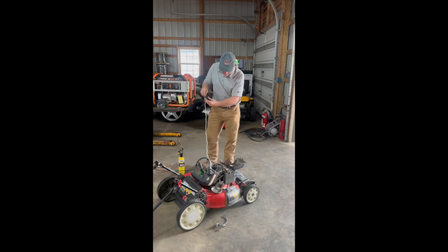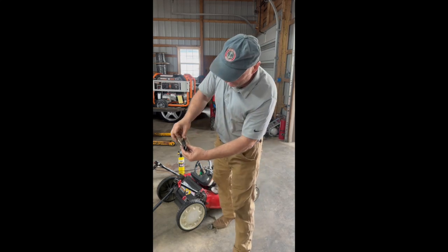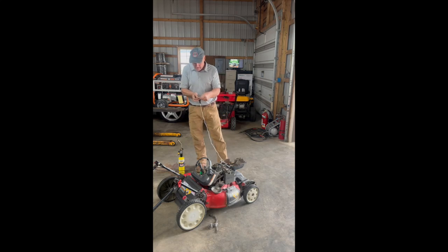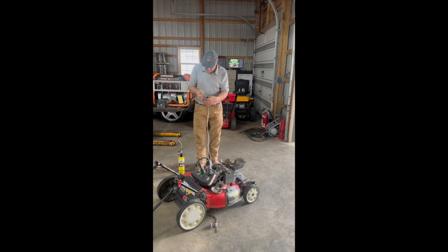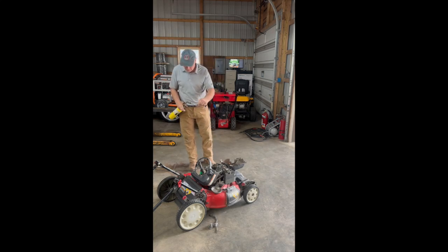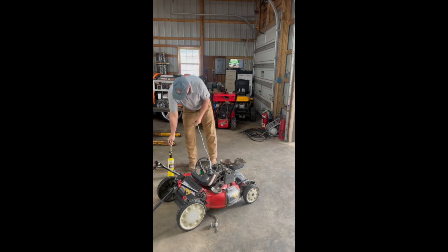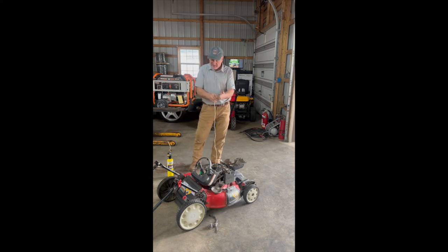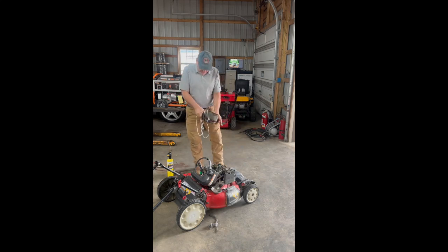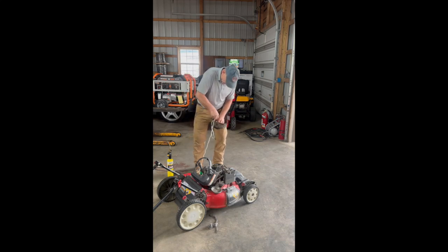All right, it's coming through. Let's see if you can see that. As I'm pushing through the bottom, it's coming through. So we'll just go ahead and tie a couple of knots in that. Okay, we're going to hit that with the torch. You don't need much of the heat. That gives it a hard feeling. That knot should not come undone. Put too much on there and you weaken the rope, and when you go to pull it, it'll rip out and break.